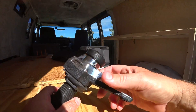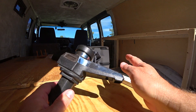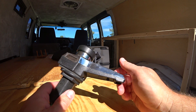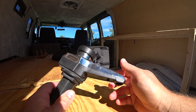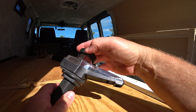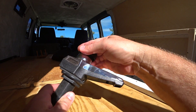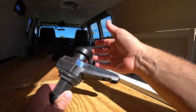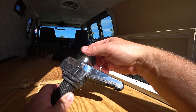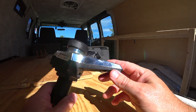If you unscrew this and you have water pressure, once you turn this so far the water starts flowing - that's if this is pressurized. Of course this is just cold water only; we're not going to have any kind of hot water system in here. And if you want to and you don't have an electric hookup - he's going to always have 12-volt electric - but if the pump fails, you just open this up and pump, and the water will start to flow, pulling from a water source. So basically this is set up for a holding tank without an electric pump, but we're going to try to run an electric pump with his setup.